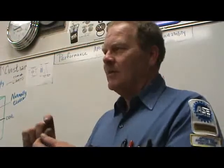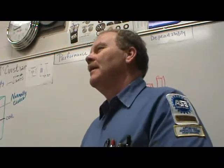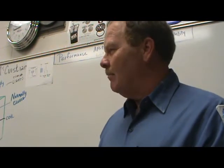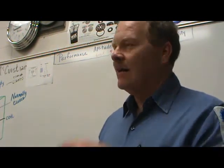You could disconnect transmission lines on the Fords. It's a little circular shaped tool where you slide it in and unsnap it. Same way with the fuel line. OTC. This one here was made just for transmission lines on some Fords. And he had one that belonged to the shop. So Ford sent one as a special tool, essential. And they let him hang on to it.